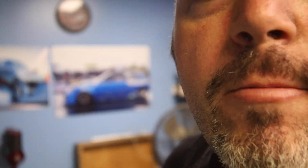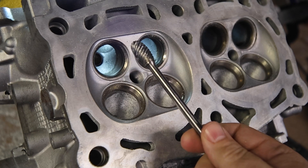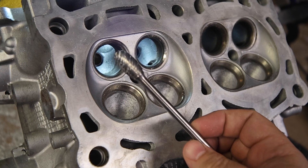Time to switch it up and do the exhaust. We're going to start the exhaust and switch over to the Head Games half-inch super spiral burr to rough it out, then go back to the double cut burr to blend it all in.